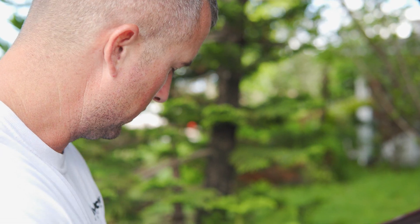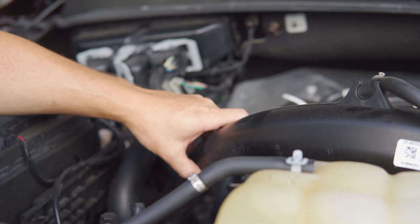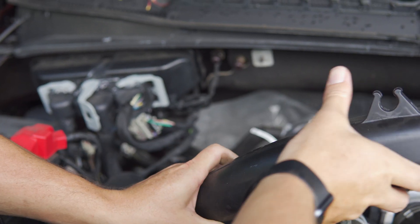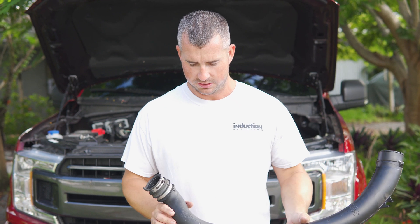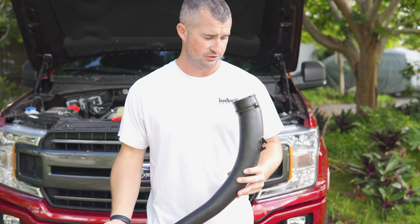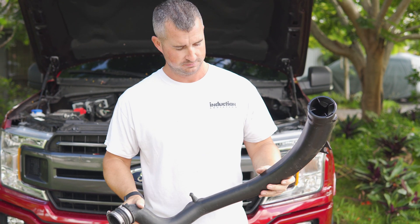It's simple — a bunch of extensions, seven millimeter, take the clamp off the turbo, pop it off its mount. The passenger side turbo inlet from Ford actually looks really clean — this truck has almost 30,000 miles on it.